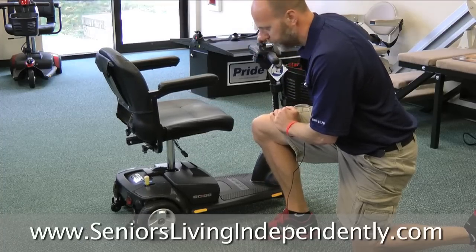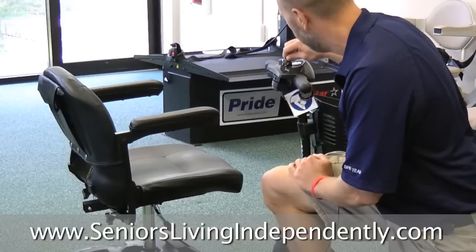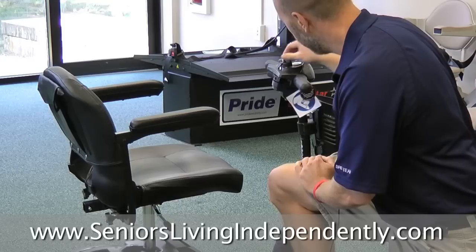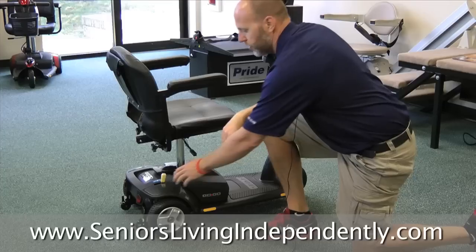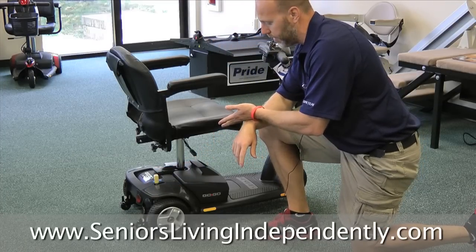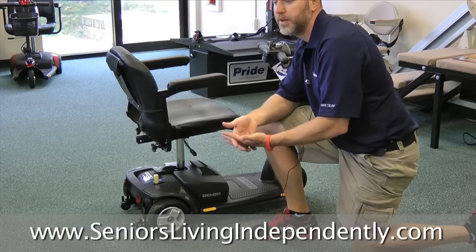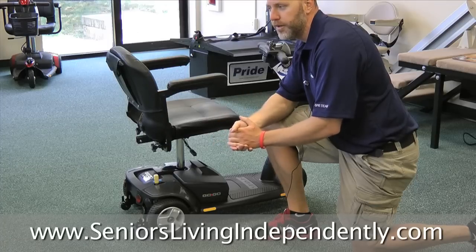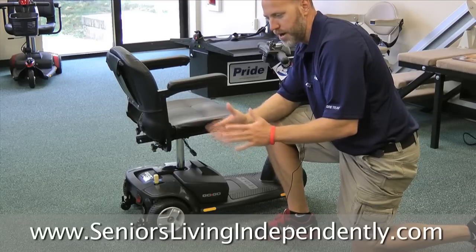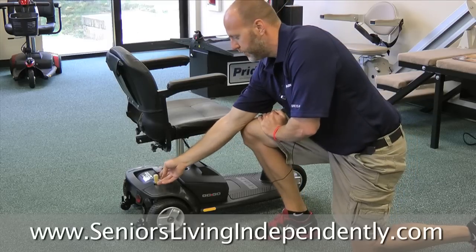What you're not able to do is drive it when it's out of gear — it just pushes. When you turn it on with the key, it's going to beep and say you can't use it like this. So what happens is somehow it gets knocked out of gear, or they take it apart and put it back together out of gear, and they turn the key on and it beeps and call us. When we check the code — the number of beeps is a code and you can look in your manual — it will say that it's out of gear. So always make sure that if you want to drive it, it's in gear.